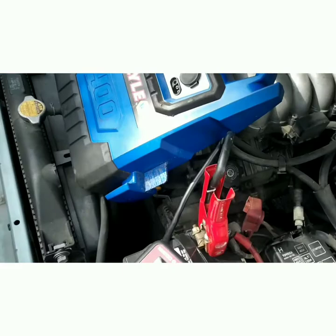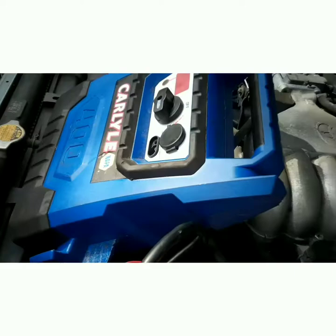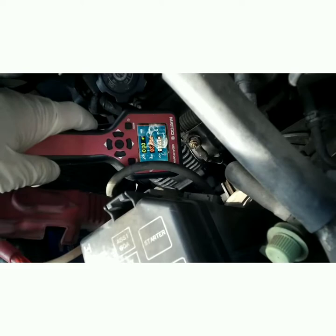That's what the regular voltmeter reads, but this is a little mini scope. You also want to pop this little cap off on the alternator and make sure that voltage wire is getting voltage down there too — if you lose connection, it won't charge. We are getting voltage there, so that pretty much confirms the alternator's bad.